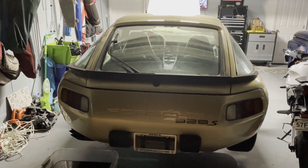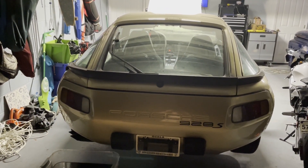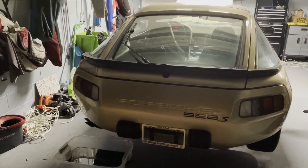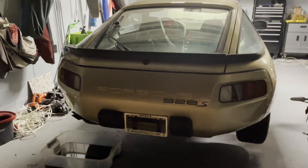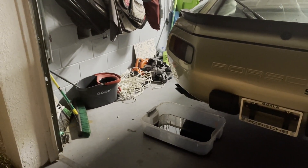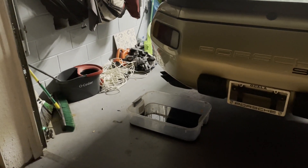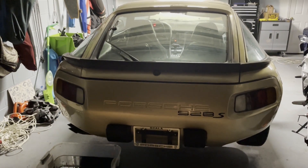We got the car running. I ran it a couple times for about 30 seconds, came back and topped off the fluid, then ran it again. Once it was pretty well topped off I ran through the gears - park, reverse, neutral, drive - pausing each one for about five seconds, then back up. Checked it again and it was in a good spot. No leaks. And here's more good news: that white smoke I had after the tune-up - now that I've got the new good oil in there - I don't have it anymore. Seems to be running good, no smoking. We're gonna call the automatic transmission fluid change done.